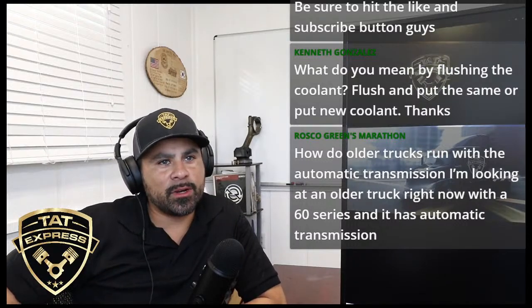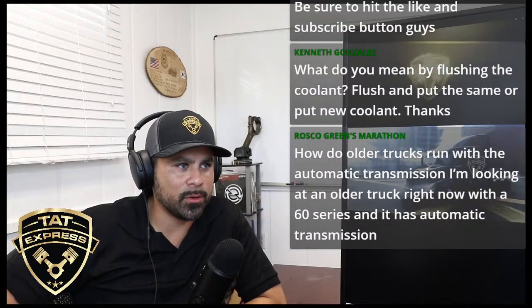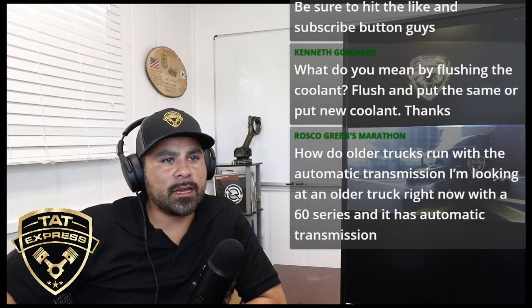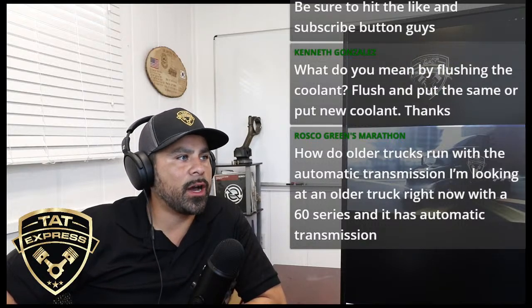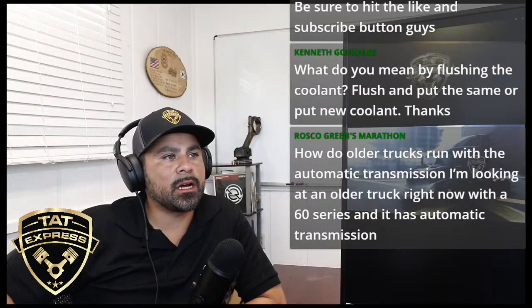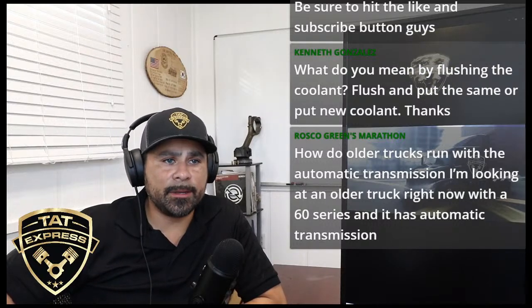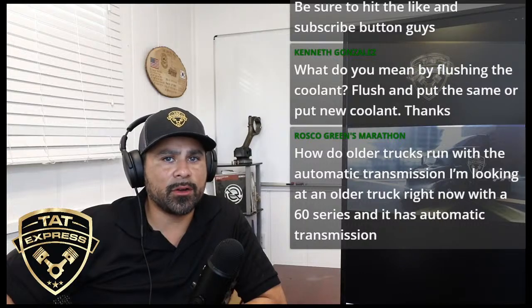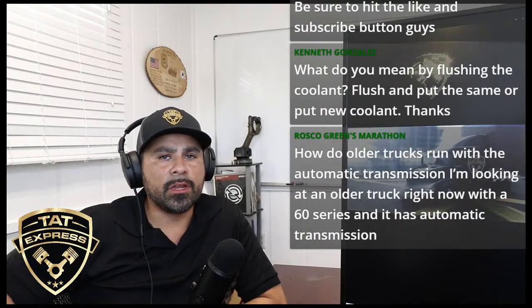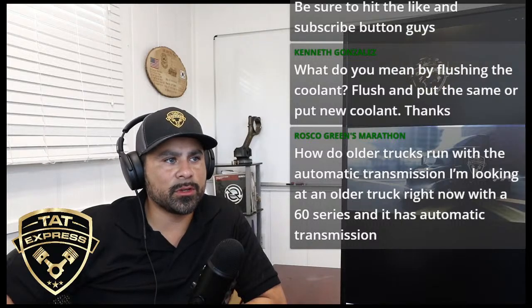A lot of times when I see trucks come in with brand new coolant tanks and they come in with the same problem about excessive pressure in the cooling system, those are signs that you have something going on. So if you got a coolant bottle that cracked and is leaking from excessive pressure, that means you have something else going on. And we're shooting a video today about that. We're shooting a video about coolant overflow, or excessive pressure in the cooling system.